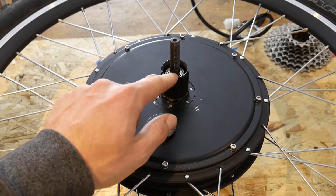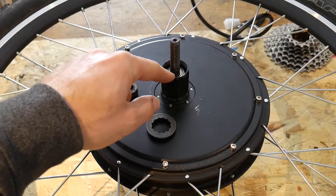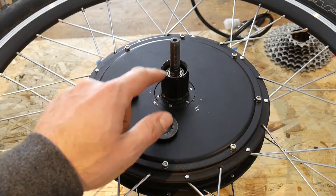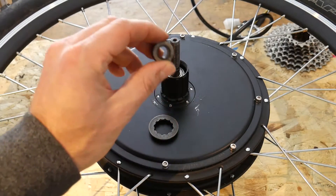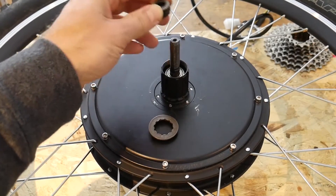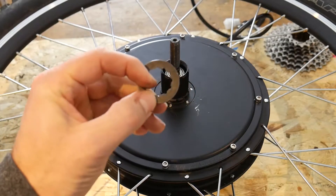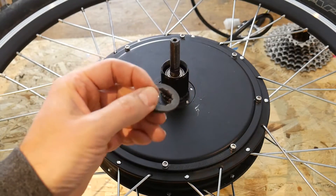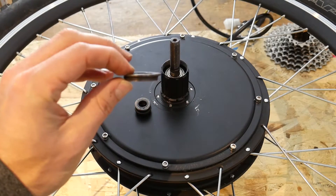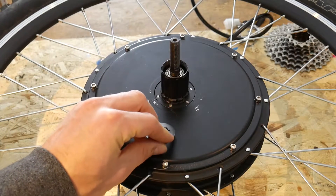If you're touching the outer race inside the hub, those washers will grind away at it — grinding little pieces of metal that find their way into your bearing, and you'll probably end up with a seized bearing. So again: the spacer needs to pass through the splines of your lock ring and then sit proud of that surface to seat against the mountain bike frame — then you'll have things working correctly.